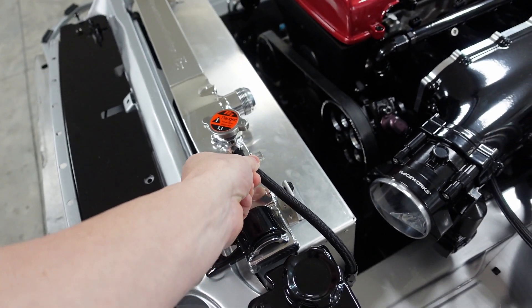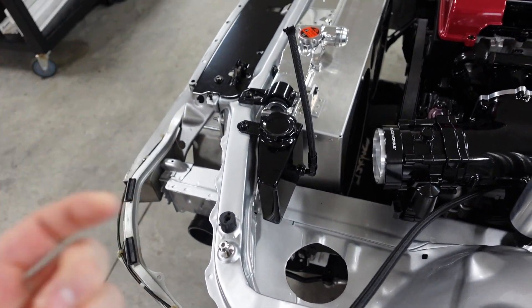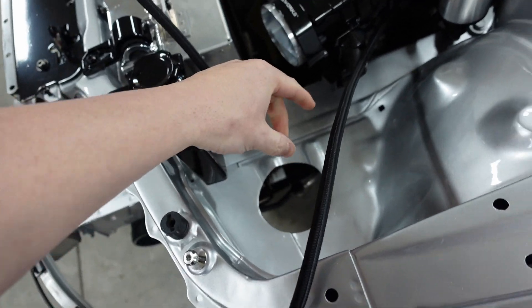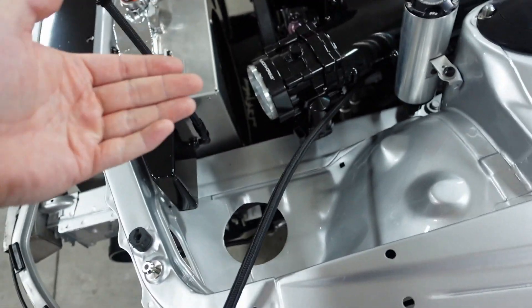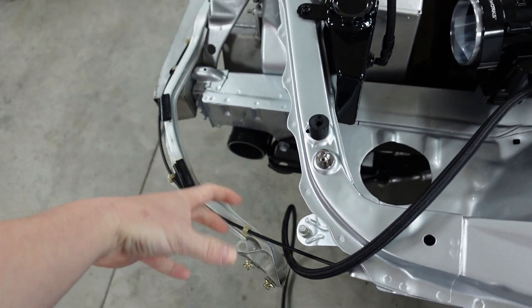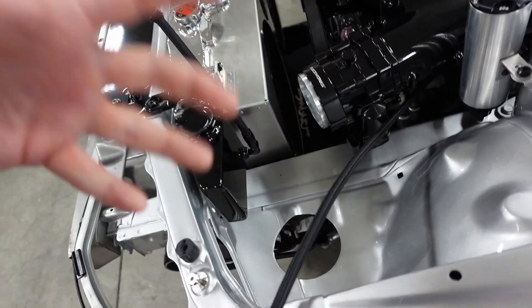I know some people think I overthink things, but I think the 30-degree fitting will look better. You don't need to run AN fittings like this, but I love the finished look — it just feels complete. I also have this long hose hanging off here because I was figuring out where to put the blow-off valve. I was going to cut it, but now that I might change the manifold I don't want to cut it for no reason. I always put the blow-off valve up in the engine bay rather than down near the bumper — it's easier to service and less dirt and debris get to it.